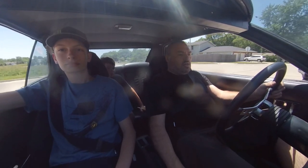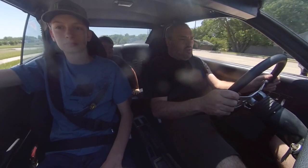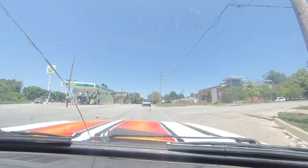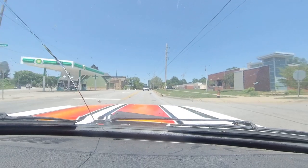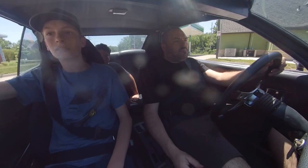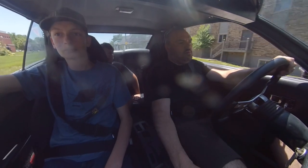No bog on the secondary there. Carried up. I think it could rev to 6500 real easy. It hit my VTEC! Yeah, there's not enough on the bottom either. Not enough in the primary yet, so both of them need bumped.